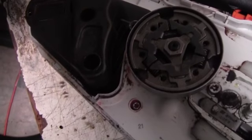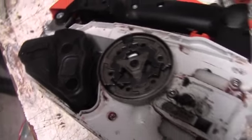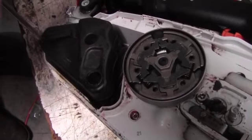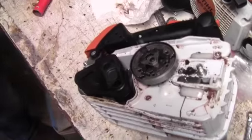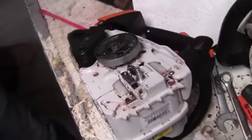Put the screen back, making sure it's sitting right, then reinstall the screw — make sure it's tight and fits in the groove. Tools go back where they came from. This is basically your finished cleaned product. Now I'm going to show you how to reinstall your cover and chain.